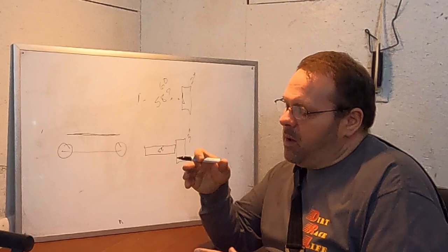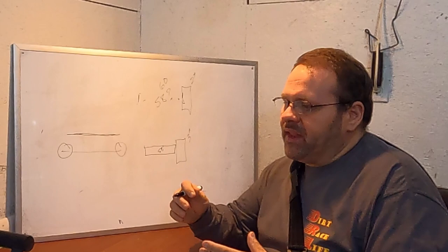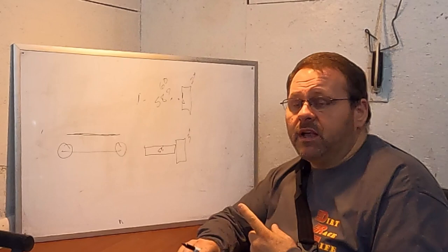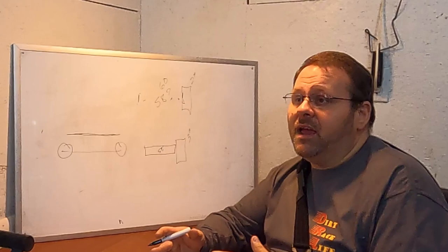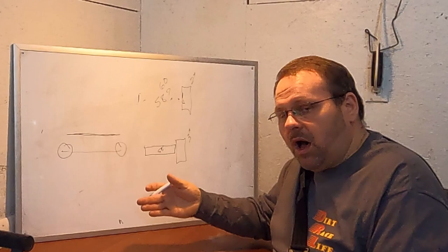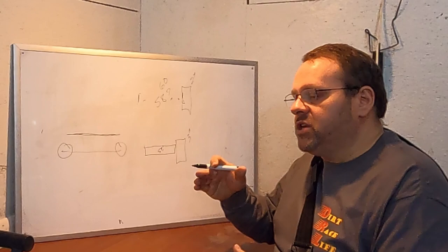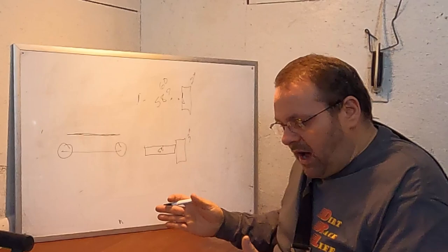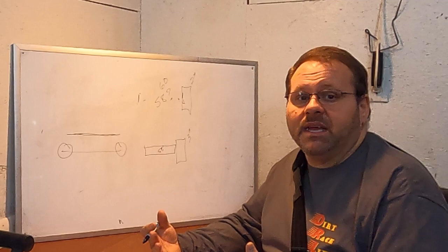From this, the only other note I could give: if you've got a car and you're struggling to get the center of gravity up enough — really struggling to get the car to get over and stay over — an option can be to tuck those wheels under the car. If you tuck those right-side wheels under the car, both front and back by another inch or two, you're narrowing that base ratio between center of gravity height and width. So you're making the car less stable, and you're also moving the center of gravity to the right. That can be a solution if you're trying to free a car up. If you're trying to tighten the car up, it's exactly the opposite.